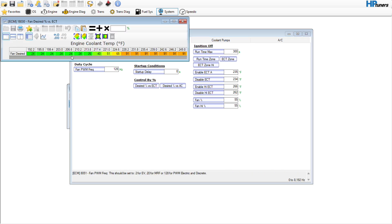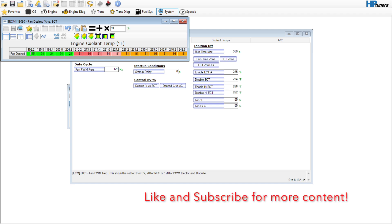We're going to go down here to the fan control. 210°F — we want this to be 91% duty cycle. Never set this to 100 — you'll burn fan motors up. Then we'll go here, select this to 25, hit equal, and then just interpolate — that will be good.